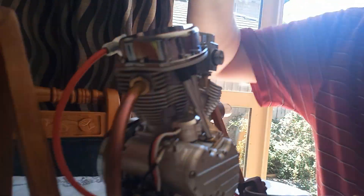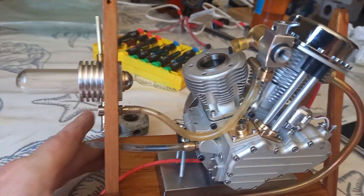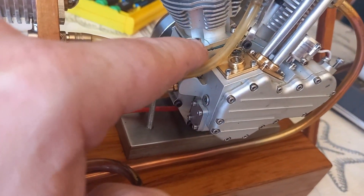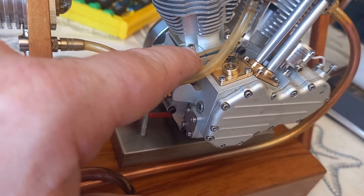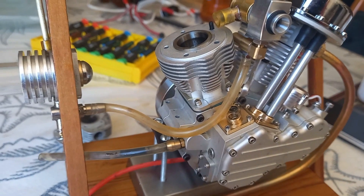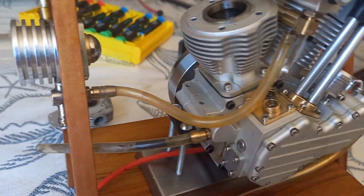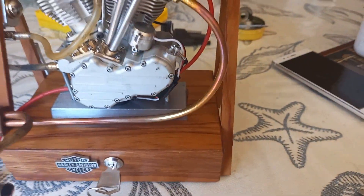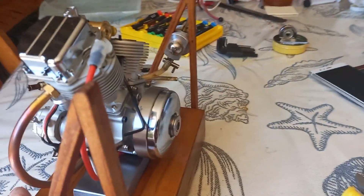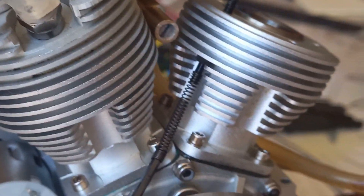I can see from the colors that have gone hotter on the other side's exhaust. To get that head off you can go for the four big screws down here, but they're pretty hard to get to. So instead I used the five little screws here, cracking them open with a modified hex key — I've left it in the socket there.